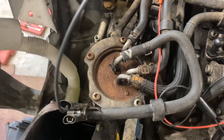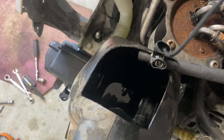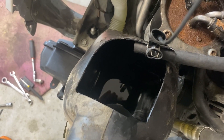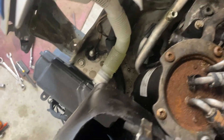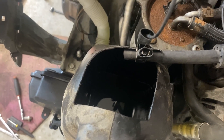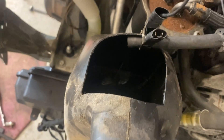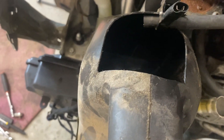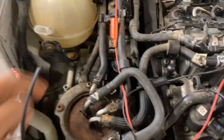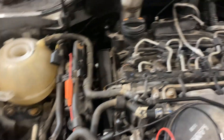So I'm going to throw a little bit of diesel in here, probably just to the top of the filter. We still have all this empty space up top that we need to get the air purged out of, but that should get the pump happy. We've filled it to just the top of the filter — giving it another try. There we go. It took a little bit, but you can probably just jump it for a couple of minutes and then you know for sure everything's all flushed out. That's the easy slash hard way to do it without the scan tool.